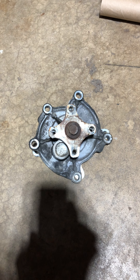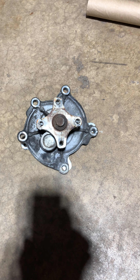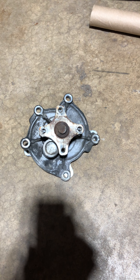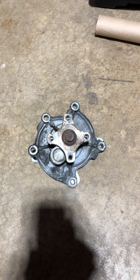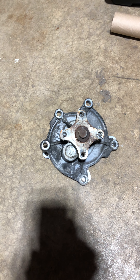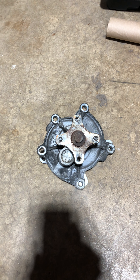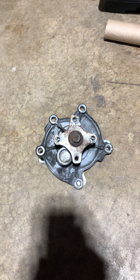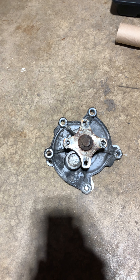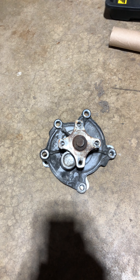The problem turned out to be the water pump, located right under the engine on the passenger side. It was a very steady drip — if I refilled with coolant and drove to work, it would be nearly empty by end of day. A co-worker noticed it and let my wife know; she barely made it home without the car overheating.